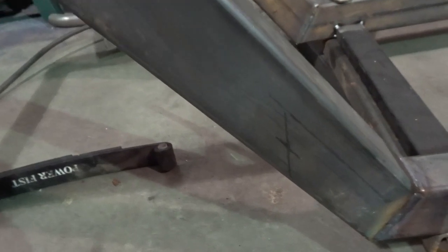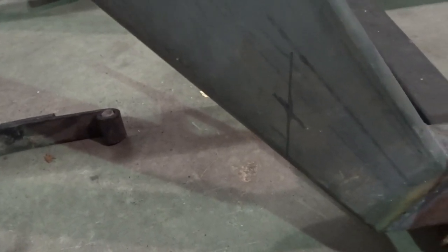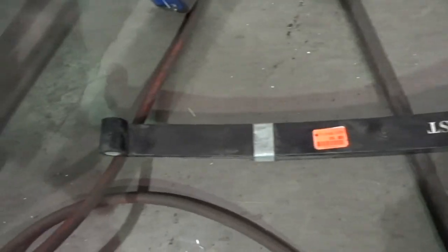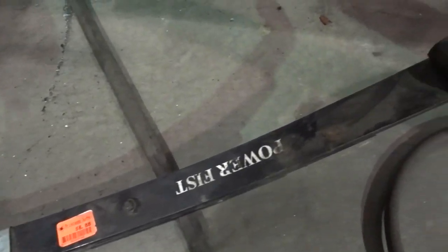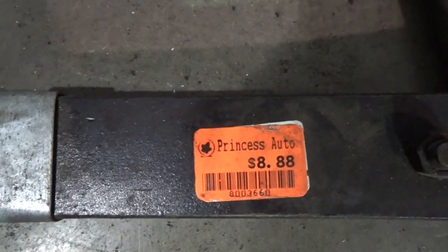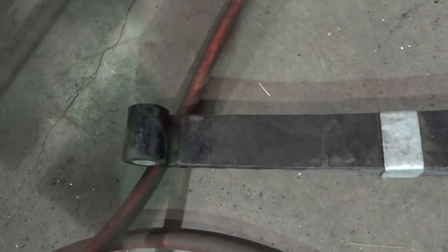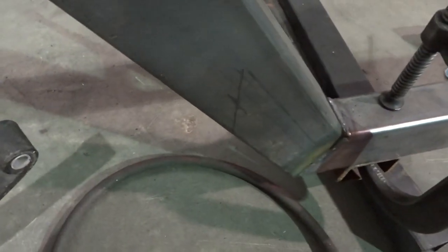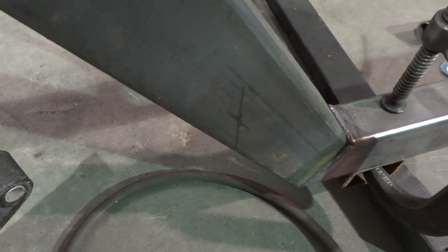I figured out ride height, and you can see that mark right there — that's where the front of the leaf spring is going to go. I'm going to pocket the inside of the frame for it. I'm just going to use some trailer leaf springs. We have a thing in Canada called Princess Auto, it's kind of like Harbor Freight except they sell all kinds of random stuff. I bought these probably 10 years ago — they've just been sitting in my garage — paid a whopping $8.88 each. They're the proper dimensions to work with this, and I didn't want to get too crazy with the suspension. I almost considered having no suspension at all, but figured it would be more realistic as a street car if it had leaf springs.